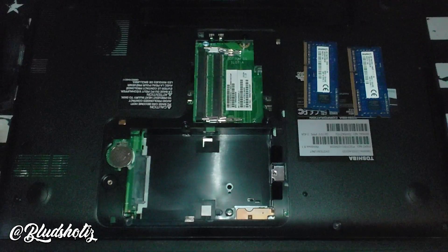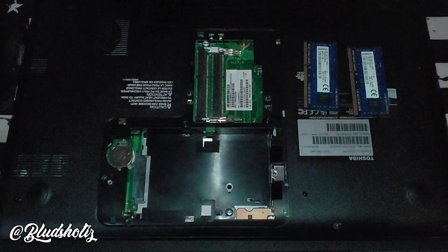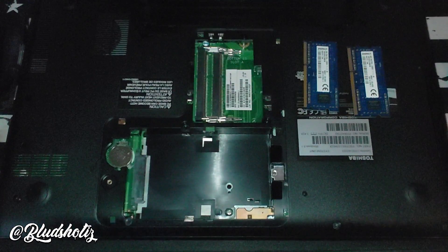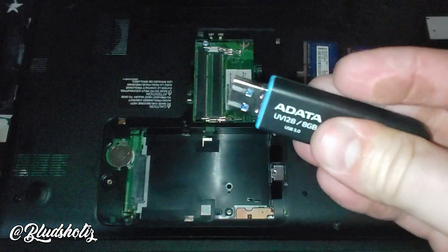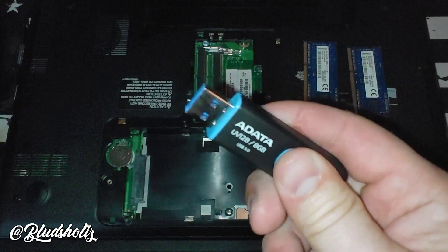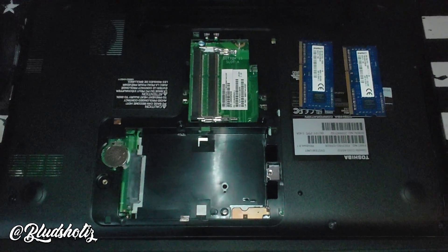Right here I have Windows 10 — the ISO file. I'll plug the link in the description. All you do is download that ISO file onto a USB drive — at least 8 gigabytes, they recommend 16. I only had an 8 gig laying around so I did it on this — this is my boot drive. Once you have that plugged in, log into your BIOS after you have the new SSD and RAM in. Go into the BIOS, change your boot — scroll over to boot and move your USB drive up to your boot drive. You can install Windows 10 onto your hardware from there. Whether you put in a hard drive or an SSD, this is a way you can take a faulty hard drive and make this PC brand new with a clean install — no bloatware.